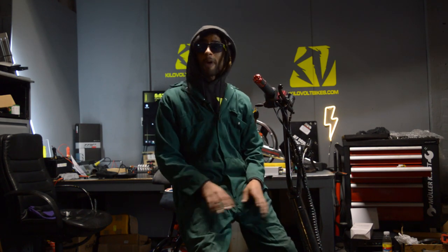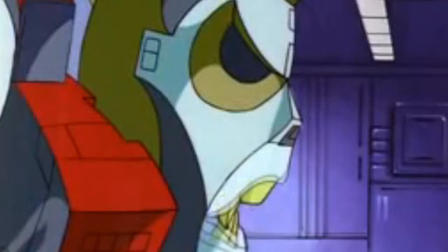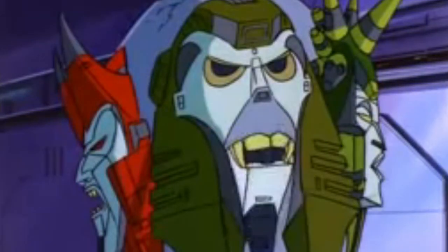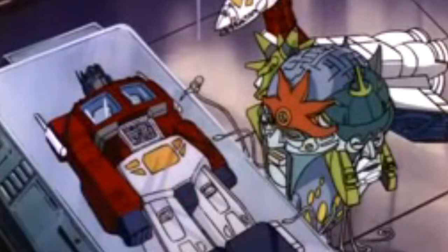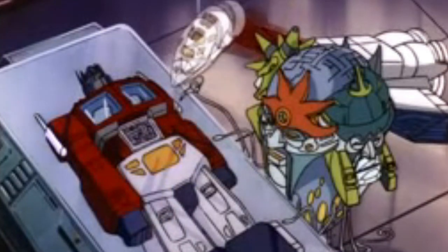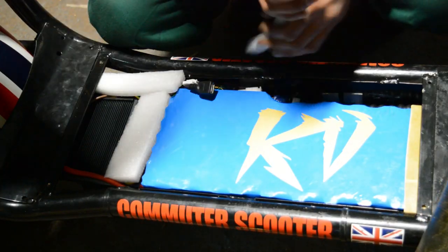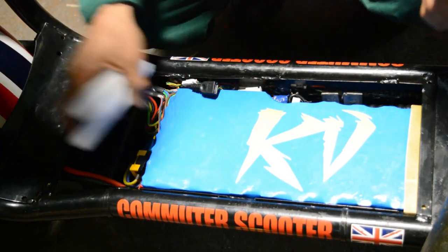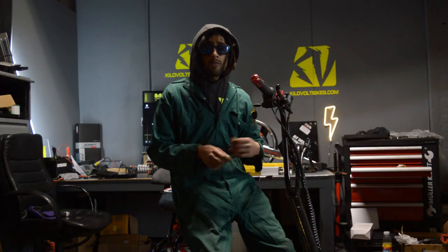So essentially, the battery's complete now. We're opening up the Citycoco. We're re-soldering all the wires and reverse engineering the original lights on there. We've taken off the old display. We don't want that anymore. Thrown that in the bin. We've now added a nice computerized, colorful display, which goes with the Sabvoton Mini. We've then sorted out all the wiring so it's not a rat's nest and made it all nice and neat. It's in there neatly. It's not just a whole bag of wires thrown in there. We've tried to take some time to zip tie them together and wrap them up where we can.